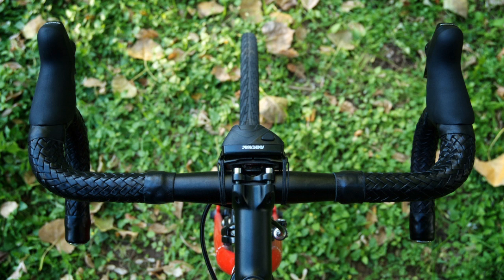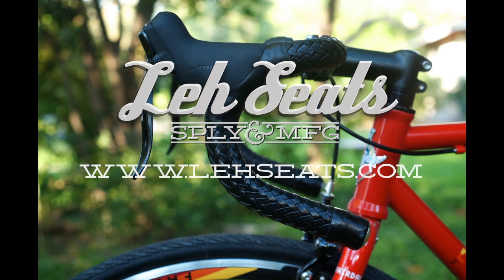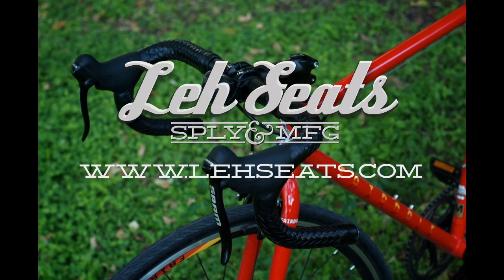When you're all finished, your bar wrap should look like this. Each edge of your bar should be taped with electrical tape on the inside and covered with the cuffs. The bottom edges can be finished either by taping the bottom edges flush with the bottom of the handlebar, or by folding them inside the handlebar and inserting a bar end. I hope this video was helpful in installing the wraps, and of course I'm always available for questions by email or on my website. Thanks from Lay Seats.